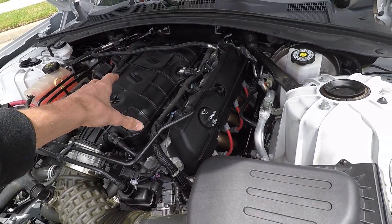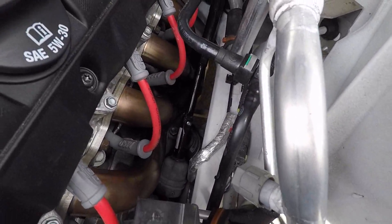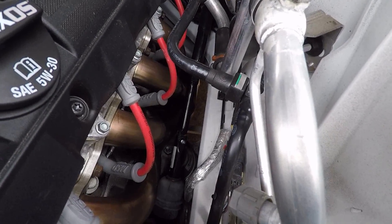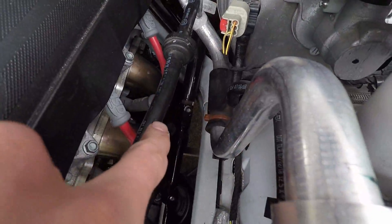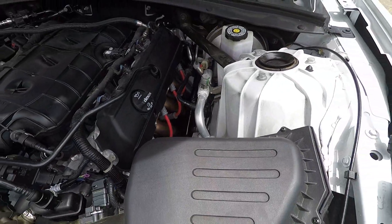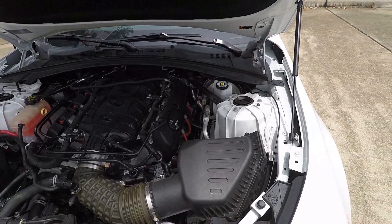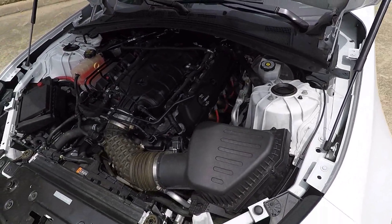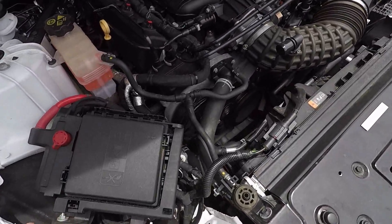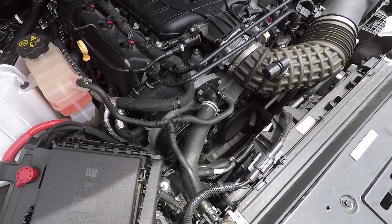The cover that was on here I took all off, so that would have been in the way. The steering shaft — mine, I don't know why, but I feel like they're reversed. All the videos I've seen, the bolt head is at the top; I had to get to it from the bottom — no big deal. Underneath the car there's a lot of stuff you have to take off: there's a little skid plate, a little support bar, and a whole plate on the bottom. You just have to take all that off so the headers will come out. It was pretty easy.